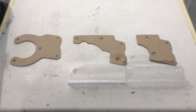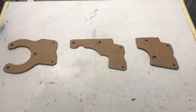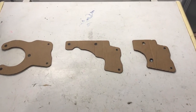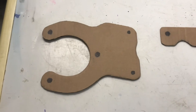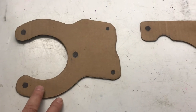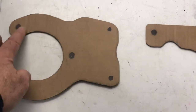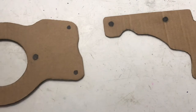Let's move on to the bracket design. I came up with three different designs, each with advantages and disadvantages. Moving left to right: the first is the classic design — another builder used an almost identical bracket. This leverages the bolts through the hubs to secure the bracket to the upright, then has holes for the calipers.